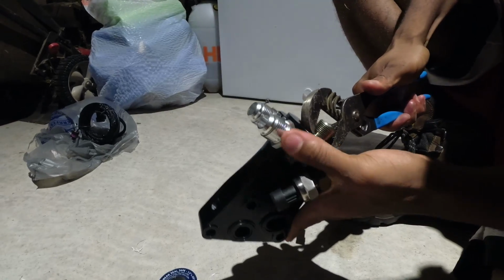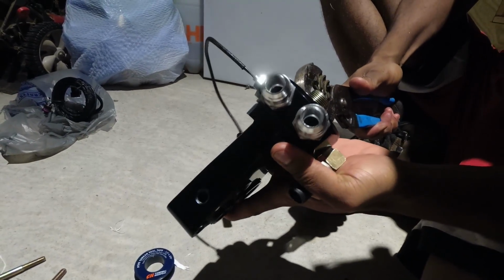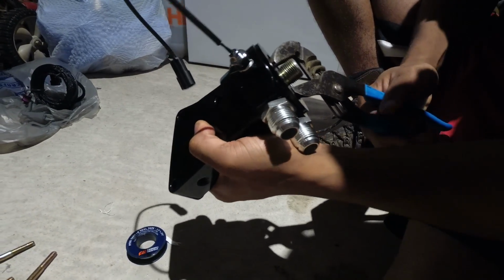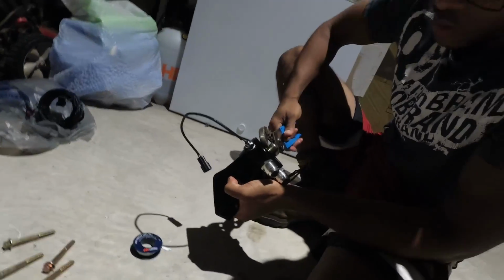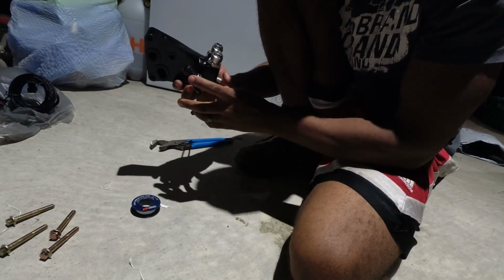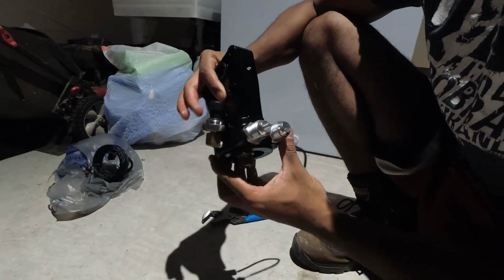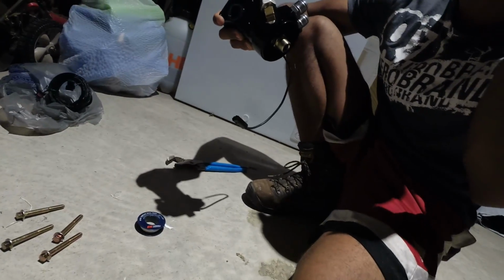All right. See here. You're going to have to play with it a little bit. You're going to have some spinning action until it starts getting tight, and then it won't move. All right, good. That's nice and tight. Slippage is normal. Don't be afraid of slipping. Just keep your face away. Exactly. So now this is almost 100% ready to mate up to the block.